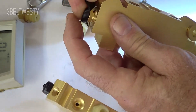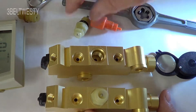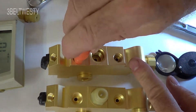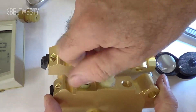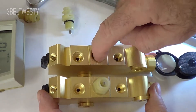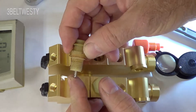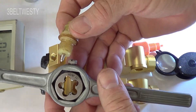That little cap goes on there like that. For the fitting, I didn't see it listed on the internet, but what I've gathered is this is a half-inch 20 thread. This one, where the master cylinder connects as input to the block, has the same thread. The switch has those same threads too — it kind of makes sense from a machining standpoint. This of course has an o-ring. Taking this old one out of an old Camaro this morning, the o-ring was basically gone, and the threads were all boogered up.